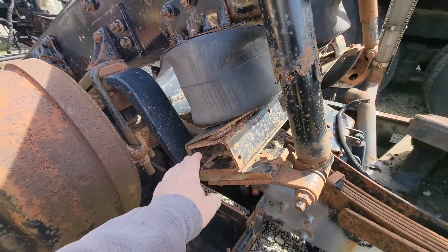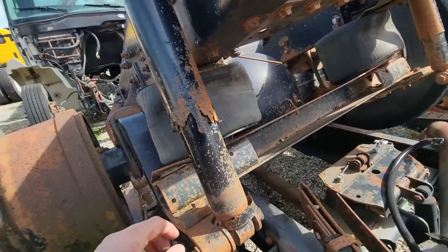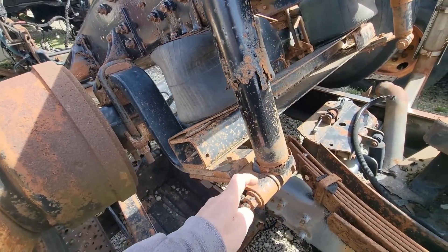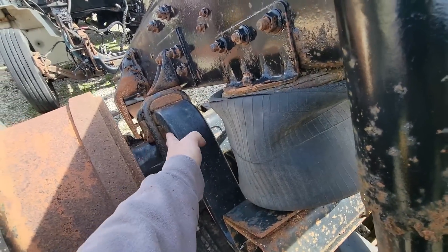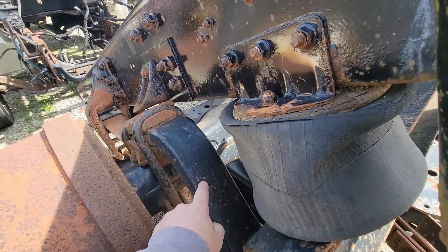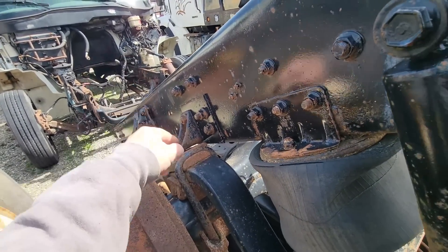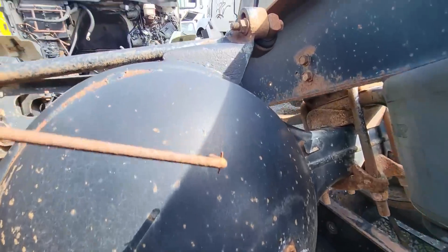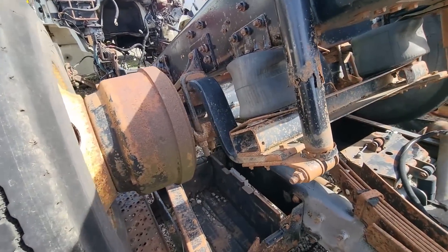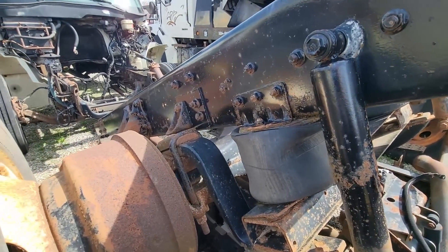Getting that bag under the frame could present problems if you're keeping your factory fuel tank, but I'm not keeping mine - my fuel tank is right in that area and the bag would hit it. I'd rather have the bags under the frame pushing directly up on the center bottom of the frame. The shock is mounted back here and out of the way. The only drawbacks are it's a three and a half inch leaf spring, and the front hanger is too tall - I don't think I can make it work.